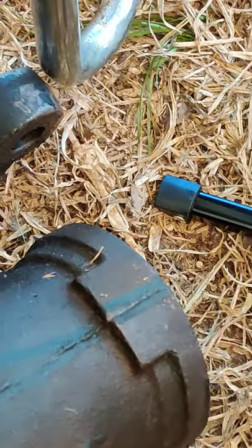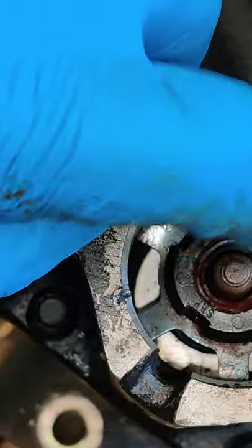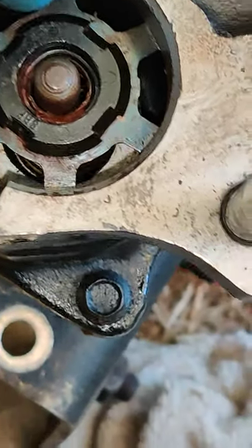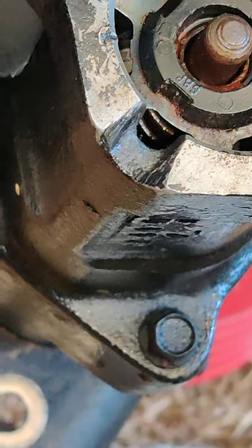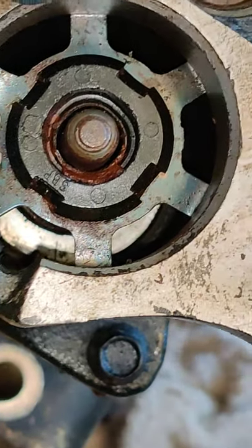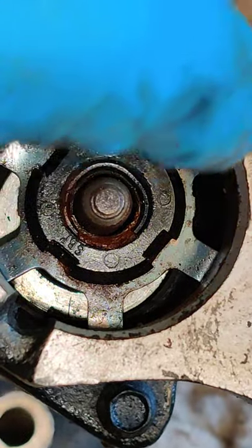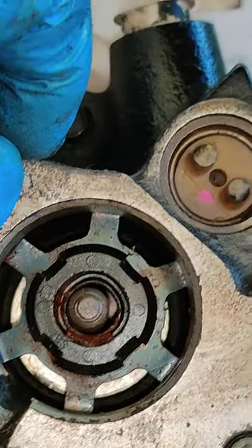That's the keeper right there. You take this keeper out of the old hydroboost. The spring — those little rings — that's the spring. At the bottom there's a little plastic keeper to keep it centered, and the only purpose of this keeper is to keep it directly centered into the master cylinder. That's brand new — I'm changing that too.